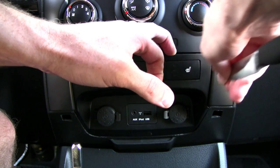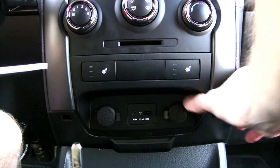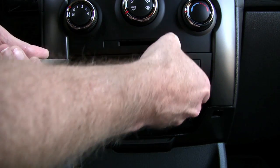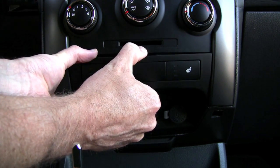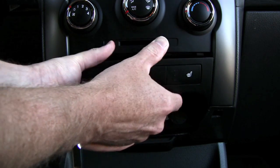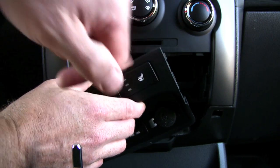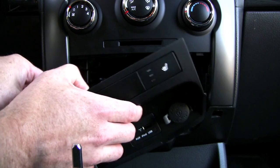There's another clip right down below, and remember there are clips on the other side too, so switch to the other side and work those loose as well. I'm going to pull the blade out and gently pull it loose — the pressure clips have a thud to them when they release. And there we go — pulled it out. Now I'm going to grab my tape measure and show you exactly where these clips are, so you'll know before you start jamming metal in exactly where to go.